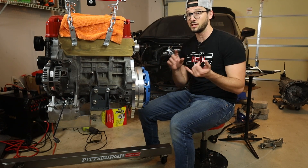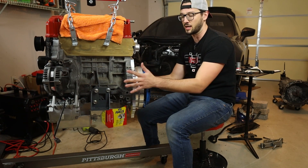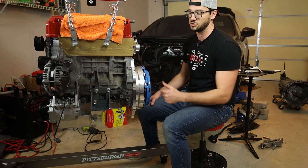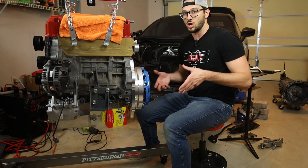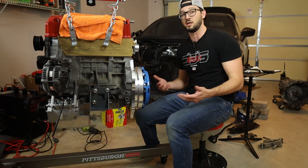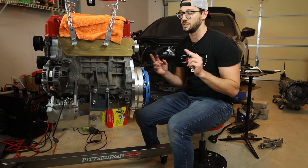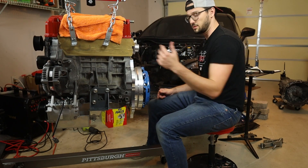With that done — hopefully correctly and on the first try, fingers crossed — it's time to put our adapter plate back on, bolt it all down, and get the starter put in place before I put the transmission onto the back of the engine. I want the starter in place because I want to know if it causes a bind when I go to put the transmission on. That'll tell me if I need to go back and clear more space. I think I cut away enough material, but we won't know until we try. Let's get this bracket bolted back on.